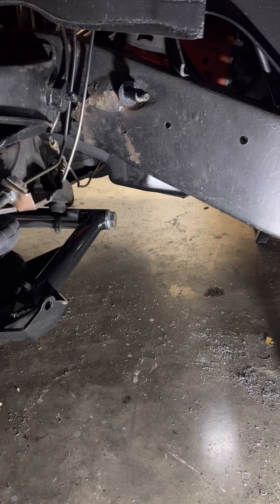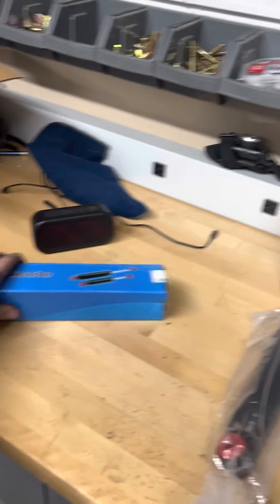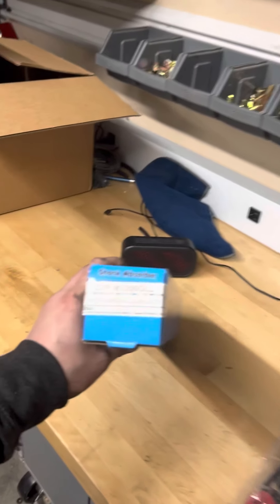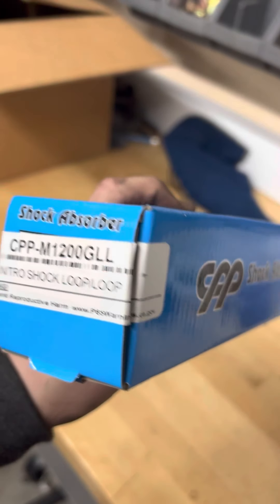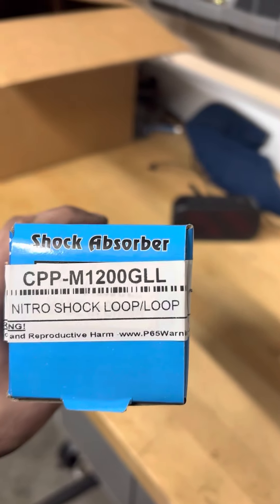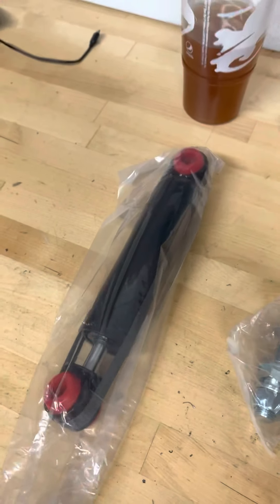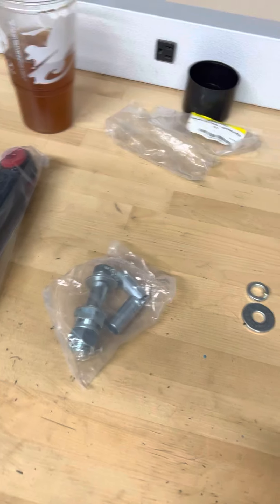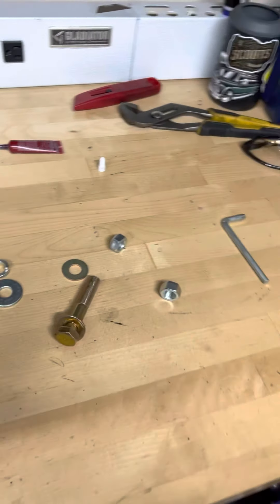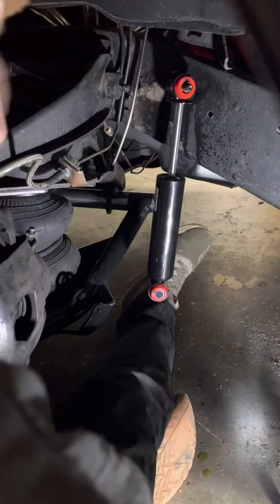You can see where the shock mounts up. Before we go there, I'll show you the shocks I ordered. From my buddy Nick Hester — he does almost all his trucks the same way I'm doing here, though he cuts his bottoms. He recommended these: CPP 3-inch lowering shocks. They work perfect for air ride — they're maxed out when it's all the way down, but at ride height they're in the middle of their stroke. Here's the part number for those. It comes with all the hardware, and the lower control arm came with the shock mounting hardware as well.